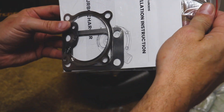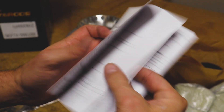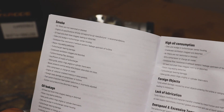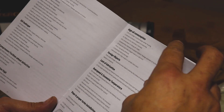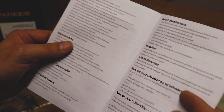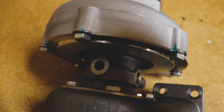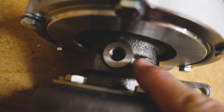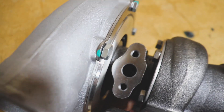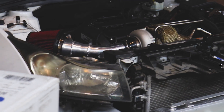They've got installation instructions now — they are stepping it up. They've got some instructions that come along with it, so if you hit a road bump, these are some troubleshooting facts you could use for your turbo. The inlet from the compressor side is two and a half inches and the exhaust side is three inches. We've got our standard oil feed here, which already has a restrictor built into it, coolant passages in and out, and a standard drain.